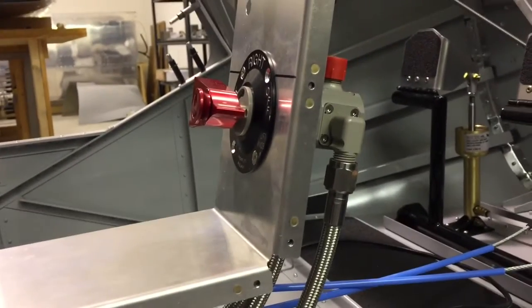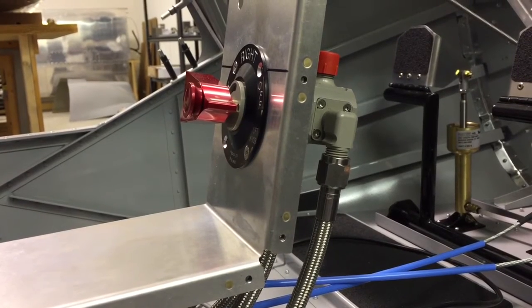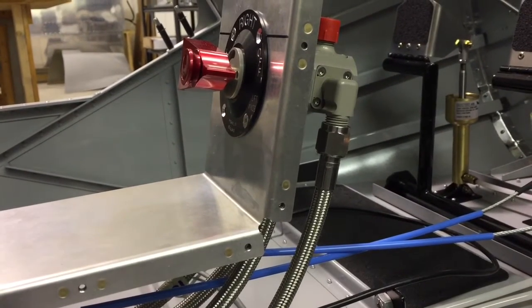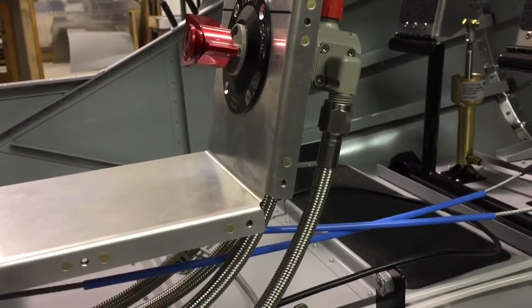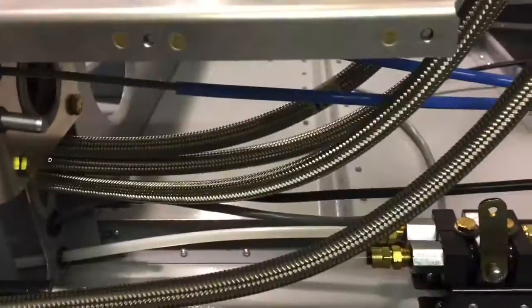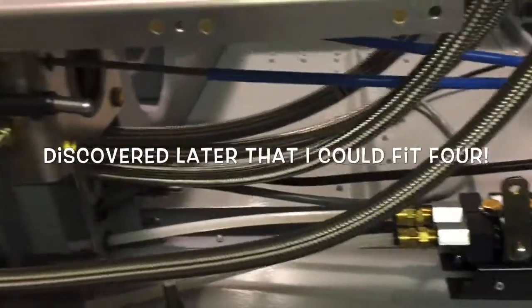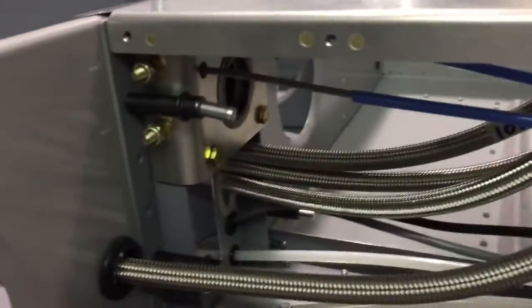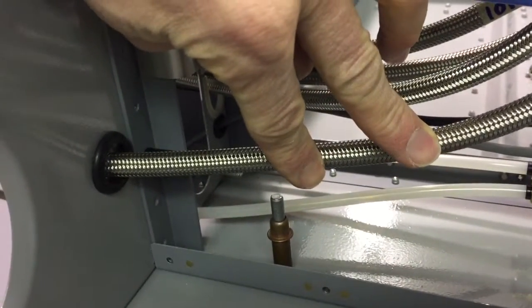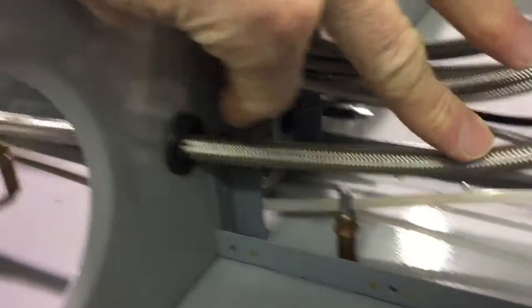I have four lines coming from my fuel selector valve. This is a UL Power 350 IS engine — it's fuel injected, so I have two fuel lines from the tank and two lines back to the tank. Three of them come down and go through the center slot through the center console. I couldn't fit four, so the fourth line comes down from the fuel selector valve, goes in between and under the center console, comes out around here, and goes back where it gets routed under the baggage seat — and then the same way as everything else under the baggage floor and on up.